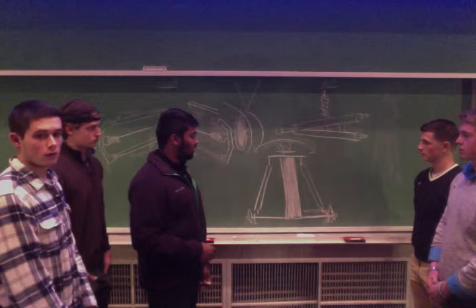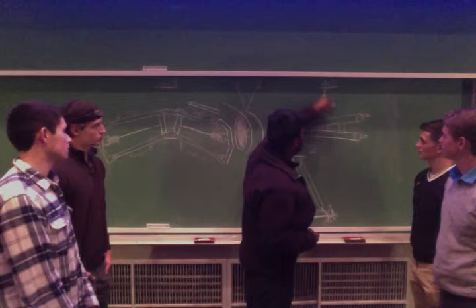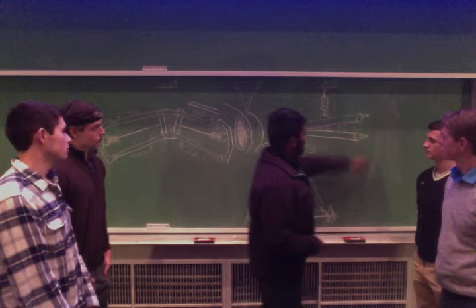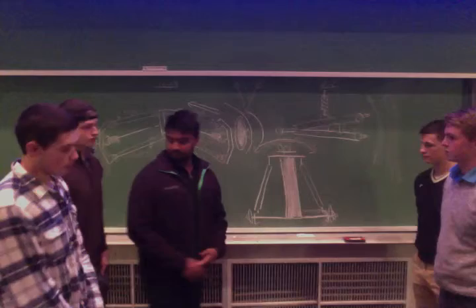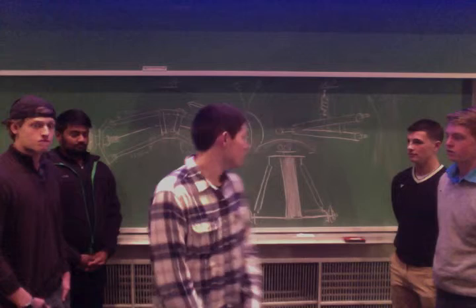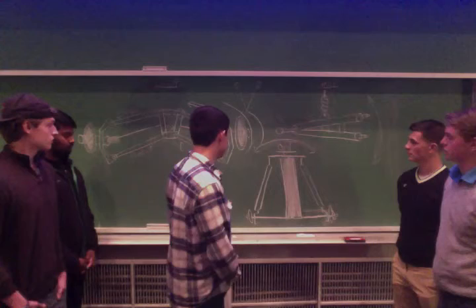This over here is a side view of the trailing arm. The major benefit is that our strut and shock are absorbed as one piece onto the trailing arm, and that's going to allow for movement in the upward and downward position. This is beneficial because it's going to be absorbing the shocks along the course. The bill of materials included in this design was two A-arms, two link plates, two pins which control the camber, and the whole frame and engine that was given to us along with the CVT.